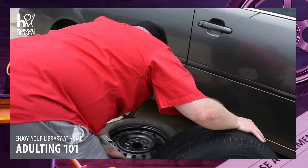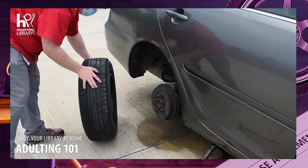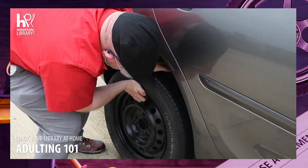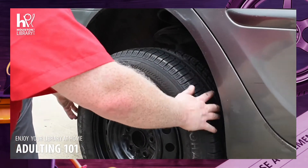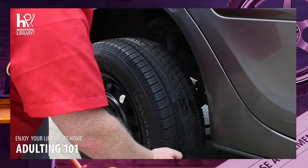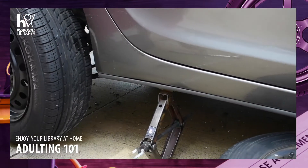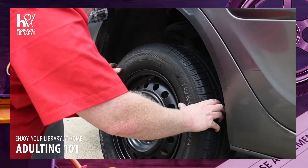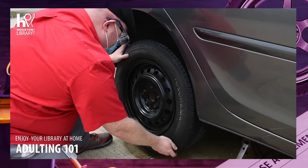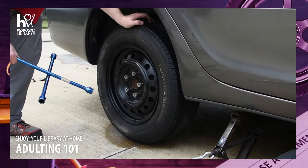We're going to replace the spare tire underneath the car with the damaged tire, so that if the jack fails, it has something to fall on. Now we're going to find where the lug holes in the wheel line up with the lugs. It's going to take a little bit of doing — I may have to actually lift the car up some more because this spare tire is a little bit bigger around than the damaged tire. But once you get one lug lined up, you can rotate the tire around it and then push it all the way on. Then you can add the lug nuts back on before you tighten with the tire iron.